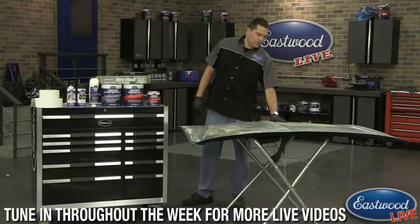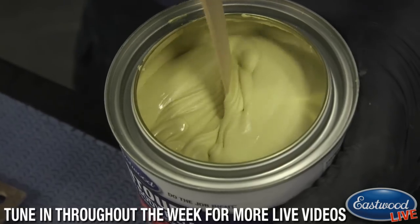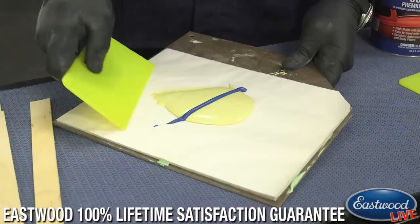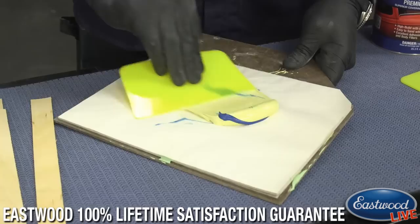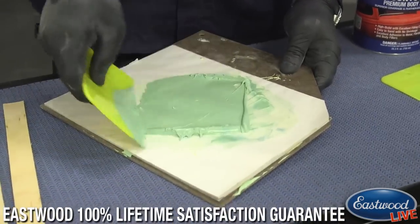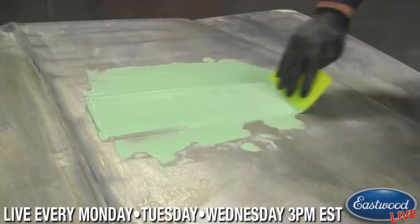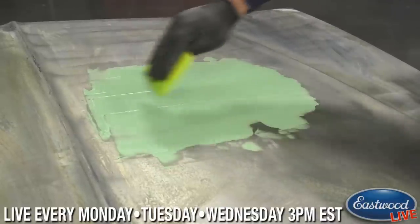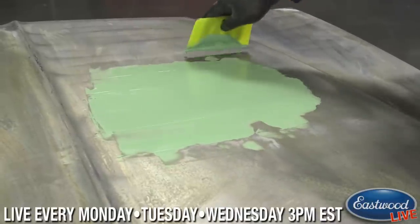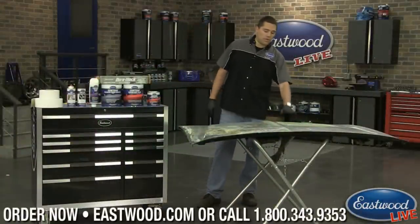Hopefully we have a little bit of B-roll as this is just setting up, getting ready to sand. Going over how we did it, you can see here it's mixed, it's consistent. There's no separation of resins. When I'm spreading it, I'm not stirring it. It's always kneading, just sliding over and over again, which gives it uniformity without adding any air bubbles. And right there was me applying it. So we're getting ready to go right now.